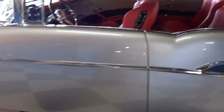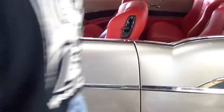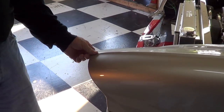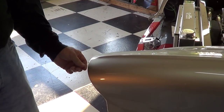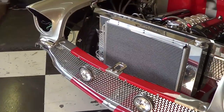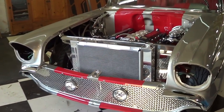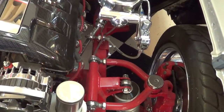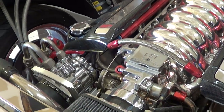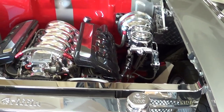Shaved the door handles off the car. We ended up actually putting two quarter panels, two rocker panels, and a trunk panel in the car when we started on it. On the front, we got some custom headlight spacers made with LED projection lights in it. We moved the top fin on the fender back, and the headlight base was just smooth across the front. We've actually got a new grill — I made a carbon fiber grill for it now with the running lights in. The front bumper is all one piece, and the firewall is all redone and smooth.